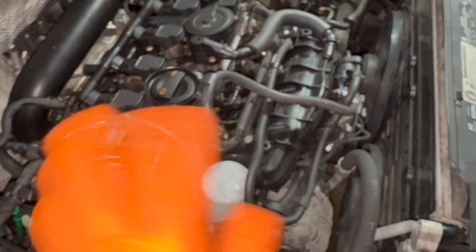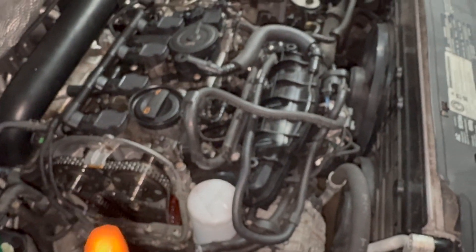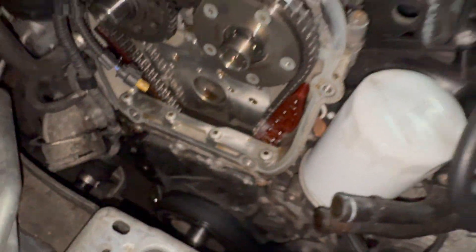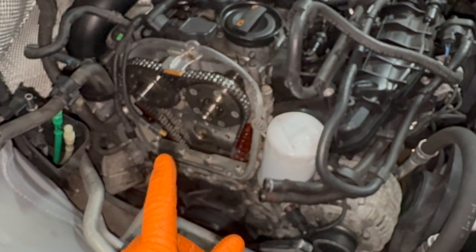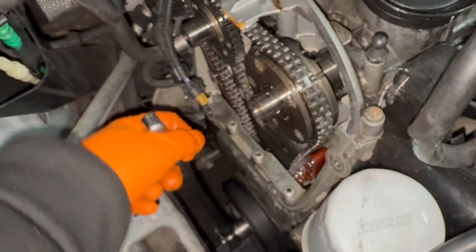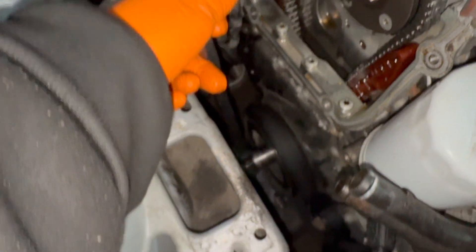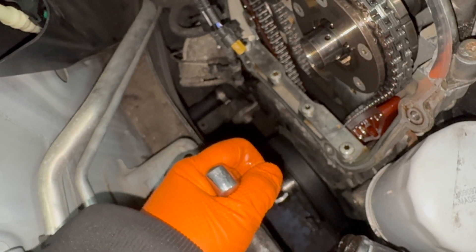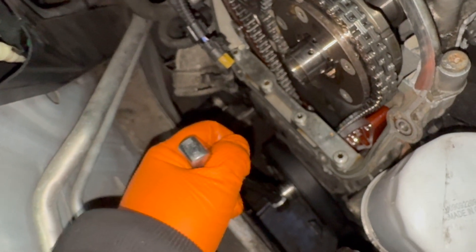What's interesting about this car I just got in: I checked the tensioner — I show you in another video how to check it — and this one has the updated tensioner, so who knows what they did wrong. All I know is that when I turn it, it's hitting something — not turning freely — it's hitting the valves.